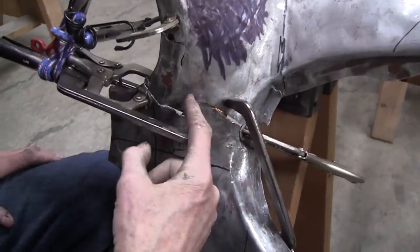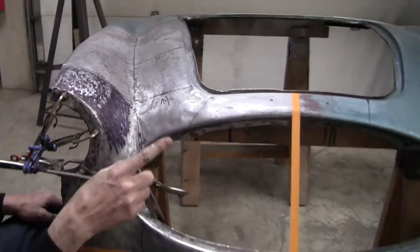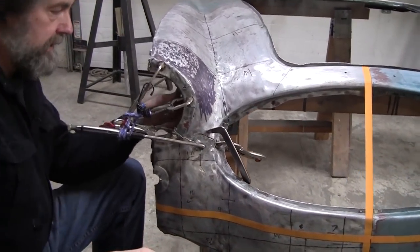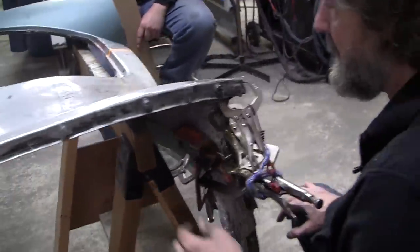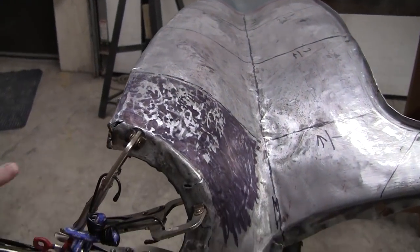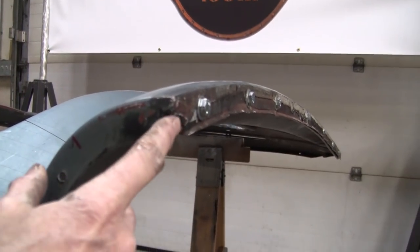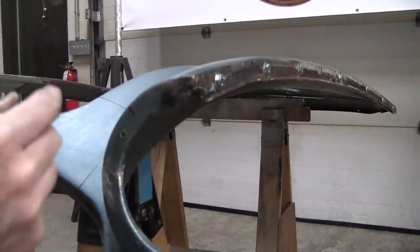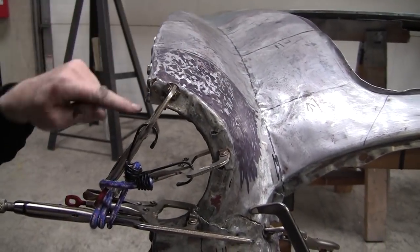This has to be cleaned really nicely so that we can weld it up. This will have to be wire-brushed really good. And we have the metal insert which was made off of the circumference diameter off of that side — a half round. So I got it clamped up really nice and tight inside here. See how that fits right up against the skin there. The situation is this still needs to come forward a little bit. This is a really odd little deal right in this corner — when they mount the headlight on there, they needed a little room for the adjuster screw or something. So they got this little odd-ball relief right here that's kind of sculpted in with the sheet metal. So we're going to have to reproduce that over here.